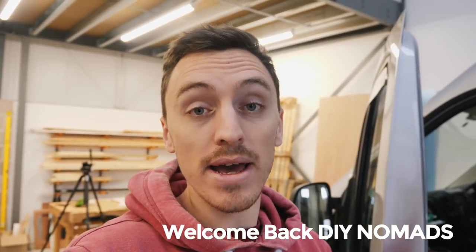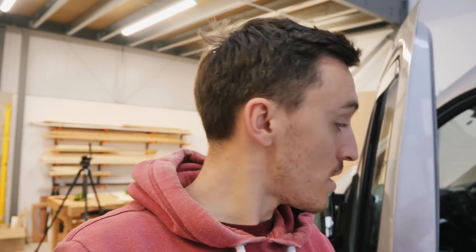My next area to attack is the roof rack. The wood roof rack is coming out because I've made it so it's basically just touching the steel roof on top, leaving no space underneath to install an extractor fan for the shower. So the wood roof rack is coming off and I'm putting back on the ulti bar roof rack I had before - the aluminium extrusion ones. I've got two bars with me so I can mount the third solar panel straight back onto the roof, and I plan to get the extractor fan mounted up there today for good ventilation.